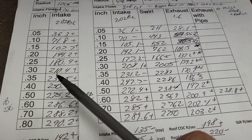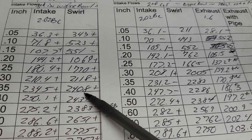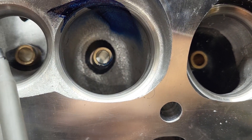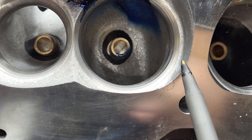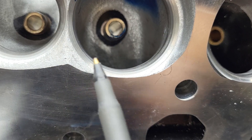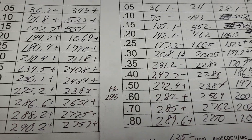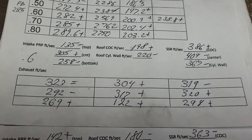Since I made the bowl wider, it's going to change our swirl — let's see what that did. These pluses and minuses are in reference to each other. The way you offset the bowl — moving this bowl over this way gives it more swirl in this direction. Notice I didn't really change the tight side. DV says keep this tight, but a lot of designs have a big piece taken out of here. I know there is flow there, but it does fight your swirl. We're right around 2600 — that's a good swirl curve, nice progression. I think it's going to make nice power.